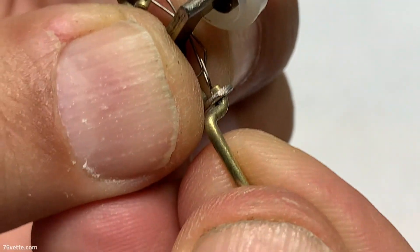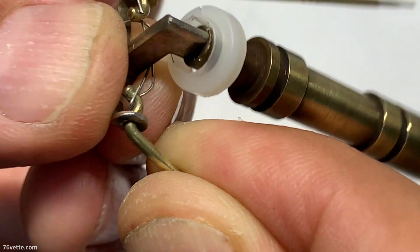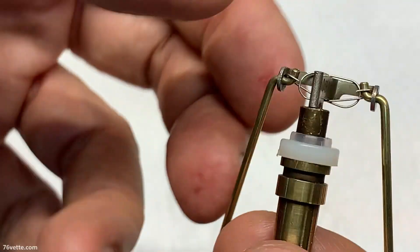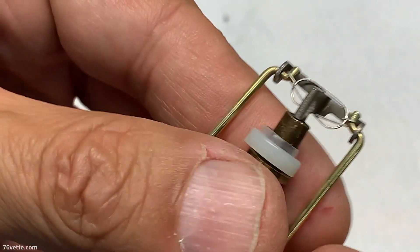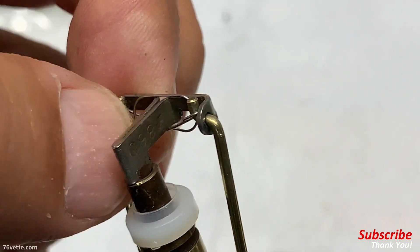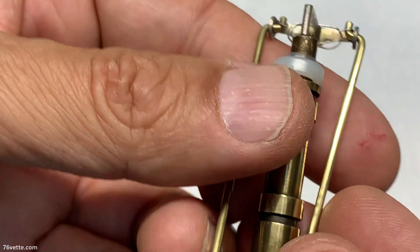You want to push it in under that loop so it keeps them in place. It's going to be a little bit of tension but that's to be expected. This is how that little retaining spring is supposed to be installed with the primary metering rods.